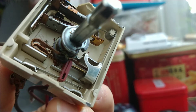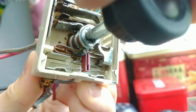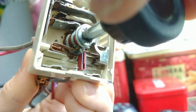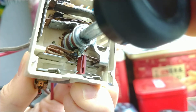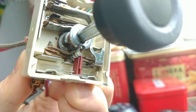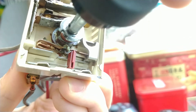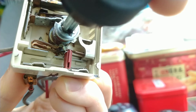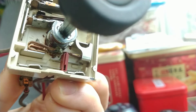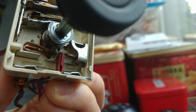Let's see the knob in action. Right now the two pins are open, below the dual elements. If you turn it on, the two metal pins will get close to the 4 and 4A. If you turn it more, then one pin will get open and only one of them is connected, so only one element is active.